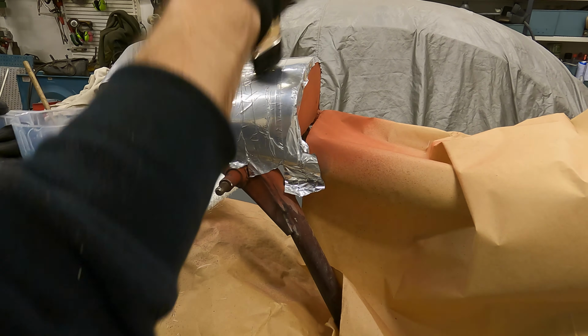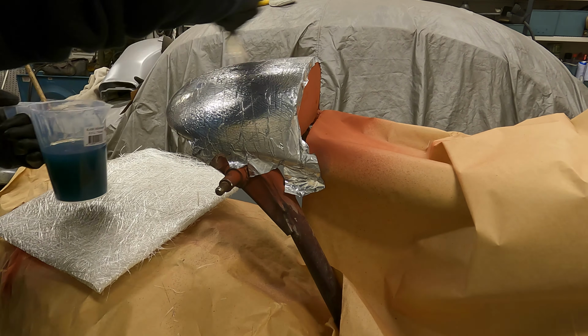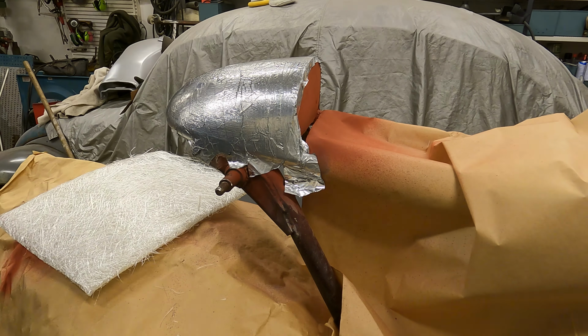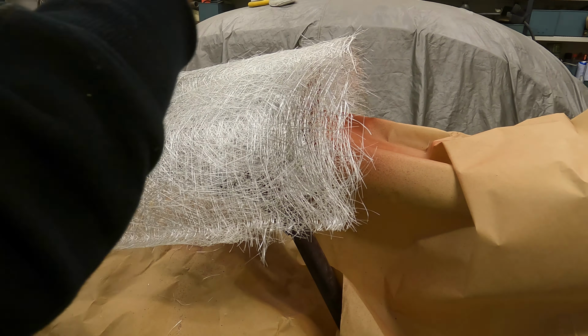After waxing, I started fiberglassing by mixing 400 milliliters of resin. I first applied a layer of resin to the bare surface. On top of this, the first layer of 250 gram fiberglass fabric. In total there were 4 layers. After finishing the fiberglassing, I left it to dry overnight and came back the next evening to remove it from the frame and mold.